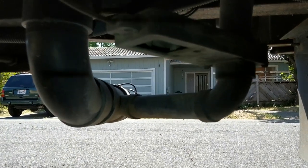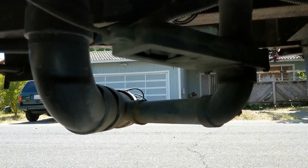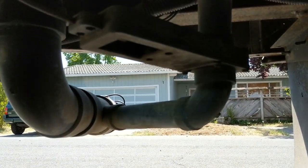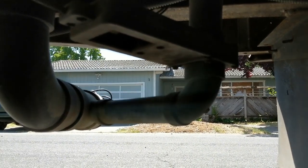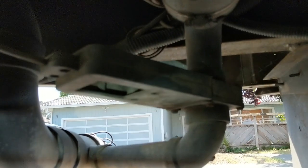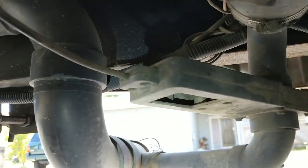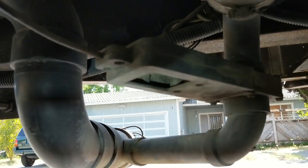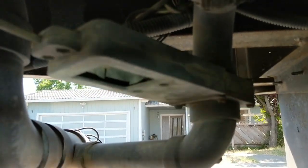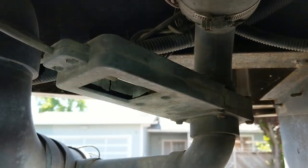What will happen is those valves will kind of get leaky over time, and there are two causes for that. One, you may have a problem with the blade valve itself, or two, the valve may just be plugged up with stuff and needs to be taken apart. These valves sell for about $65 a piece on eBay with the cable assembly. But before you go and drop over $120 on new valves, it's worth getting under here and taking them apart to see if something's gumming them up.